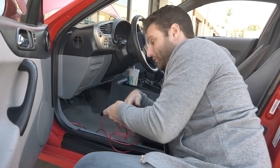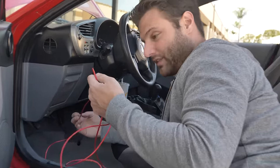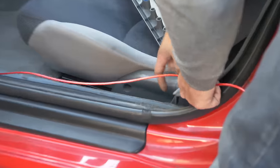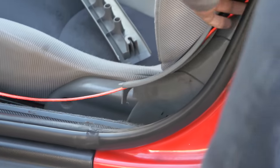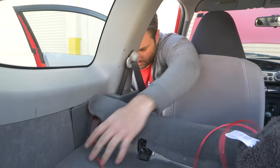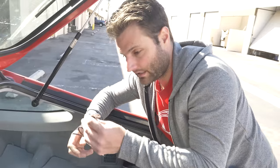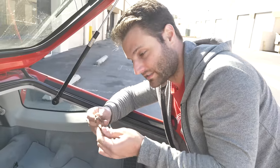This is really why you want that fuse on this line. This is in an area where it's going to get a lot of traffic, and if this wire shorts to the body of the car, there goes your battery, or here comes a big thick fire wire. And there we go — we are about 90% of the way to the subwoofer. Grounding is one of the easiest steps. We'll just find something that shorts out to the frame and properly attach it to the ground wire. Power runs through the full circuit, so this gauge of wire is the same thickness as the power line, and that is for good reason. Power goes in a full circle.